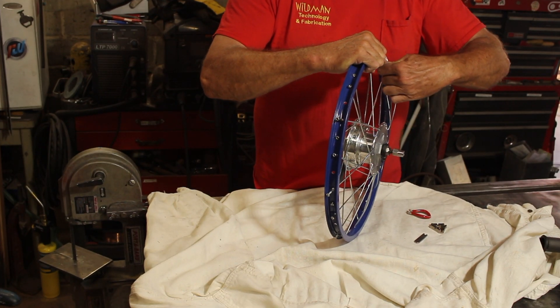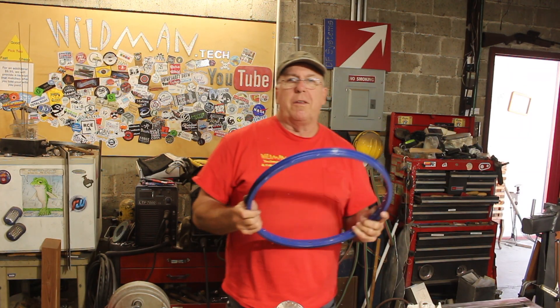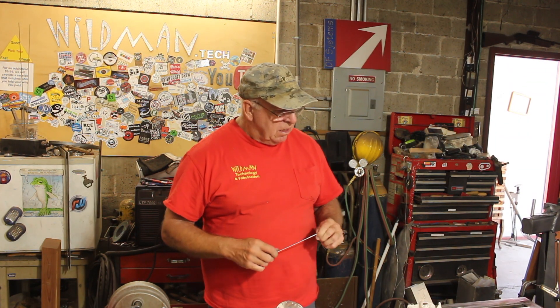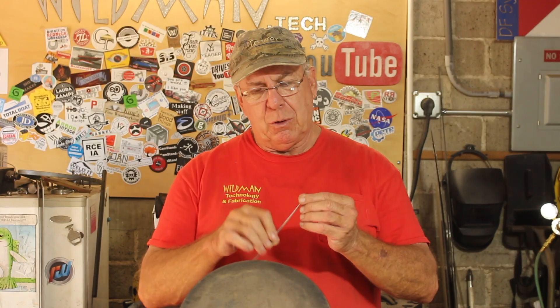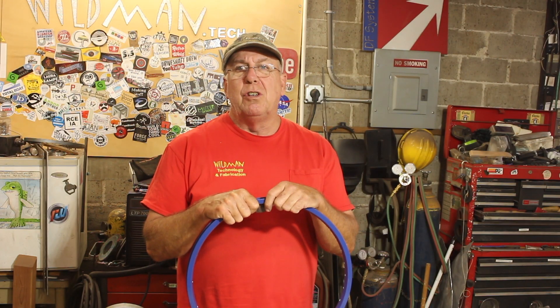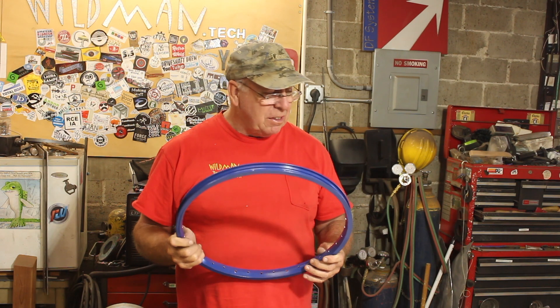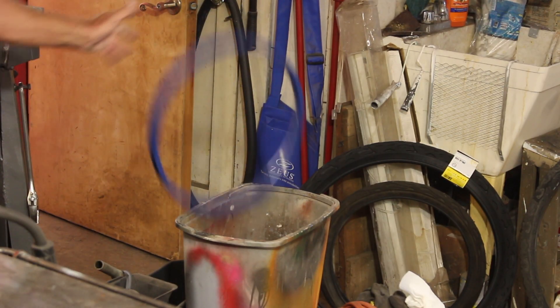One thing just occurred to me — I probably should have measured these to make sure they were the size I thought they were. After all that, I have unlaced the wheel. Not only was I short three spoke nipples, but of the 33 spoke nipples they did send me, not one of them has the correct thread. It will only thread on about a turn and a half. I reached out to Amazon and they gave me my money back and I don't even have to return these. This introduces a new level of suck because I drilled out this rim to accommodate those 12-gauge nipples, and now I'm not going to be able to use it either.